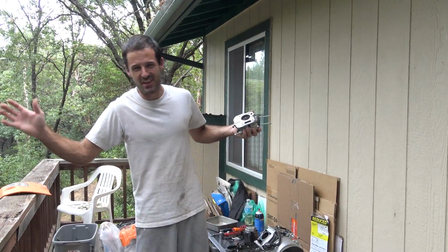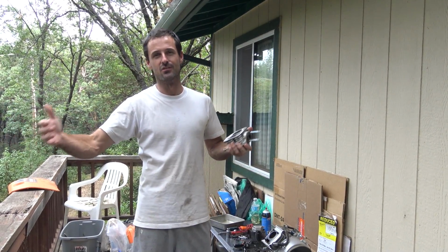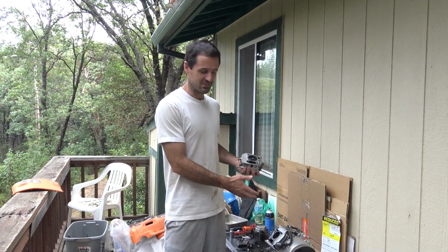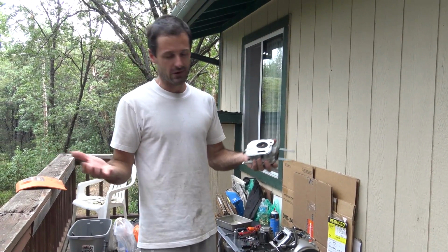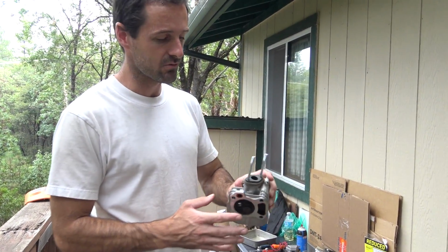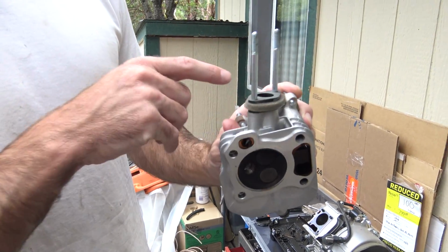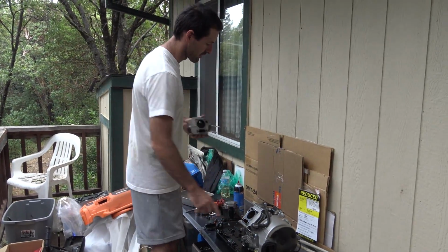No, I'm not going to do you that way. Anyone willing to watch this much of one of my videos deserves a prize for their sacrifice. I was really surprised to see what it looks like in here. The head looks perfect, but that's kind of what I expected. I didn't think anything was wrong with the head because all of the compression loss that we experienced wasn't through the intake or exhaust ports, rather it was out of the crankcase.